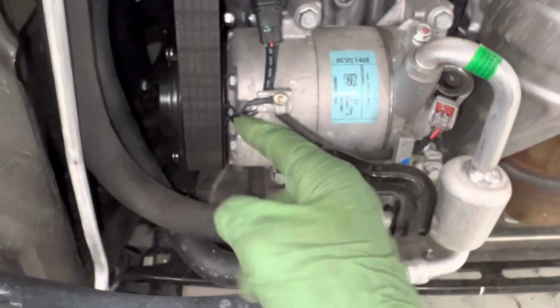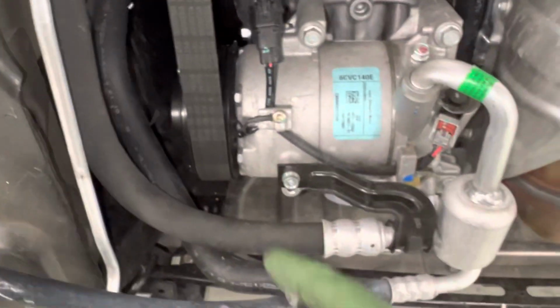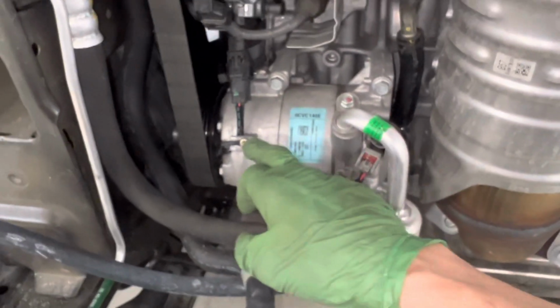Here's the ground screw. If you look right here going into the coil, real carefully right there, you only see 2 wires, and they're going into the clutch. That is your electric field coil. That's your inductive coil that makes a magnet. And basically on this one right here, its power goes in, and then another second little wire comes out, and it just grounds to chassis. So there's your 12-volt coil, just like a light bulb would be, but more like an electromagnet.